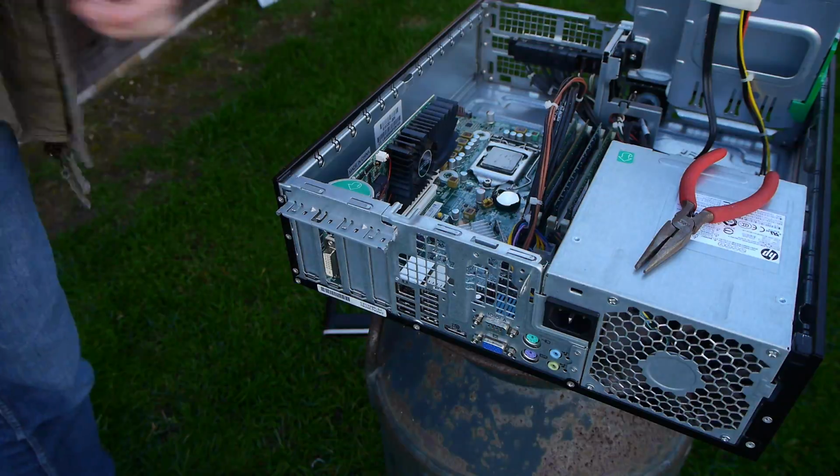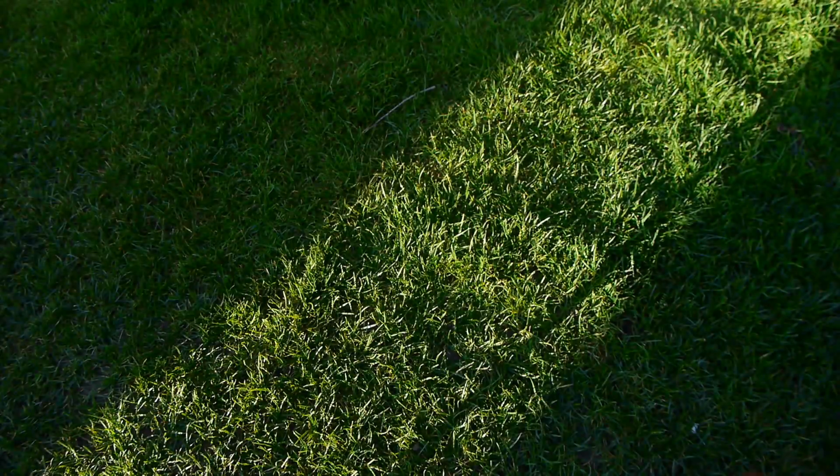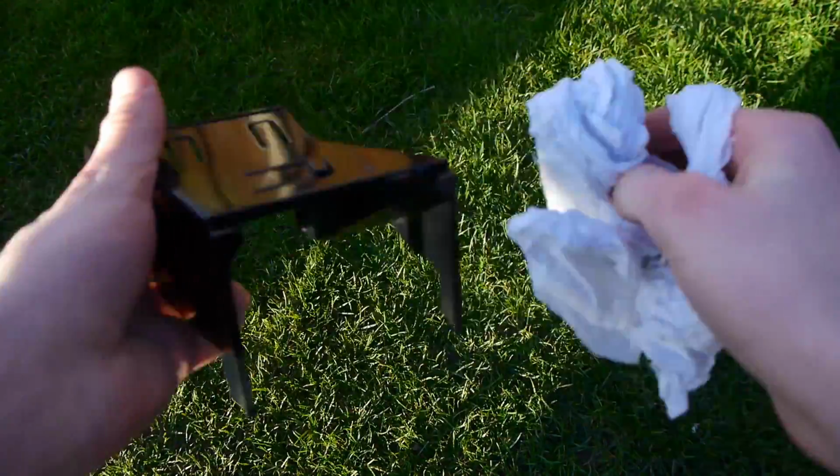I mean, that's what I did with this HP, and people are sticking in things like an HD 8490 in it and it was working fine. Of course, the R9 255 consumes more power than that, but realistically, I'm not too worried that it won't work. Generally, if you don't need a 6-pin connector, you won't need to worry. However, do keep in mind that Googling your model number can verify this for you.